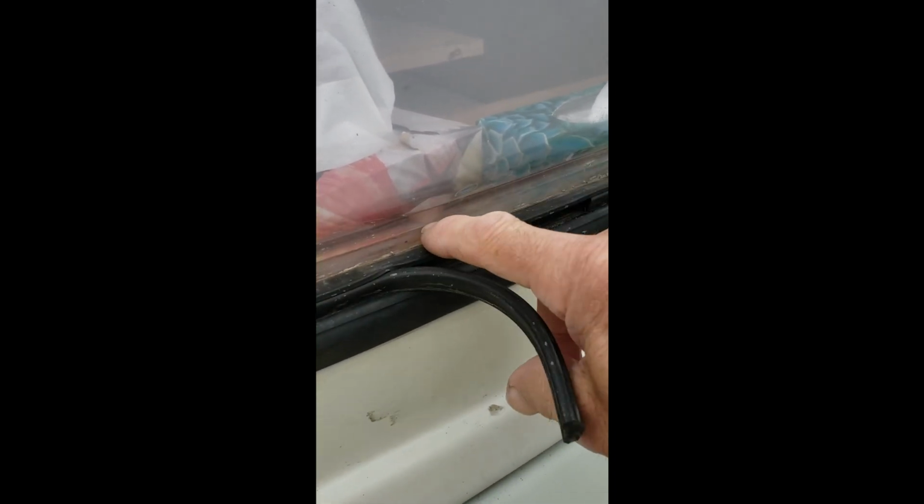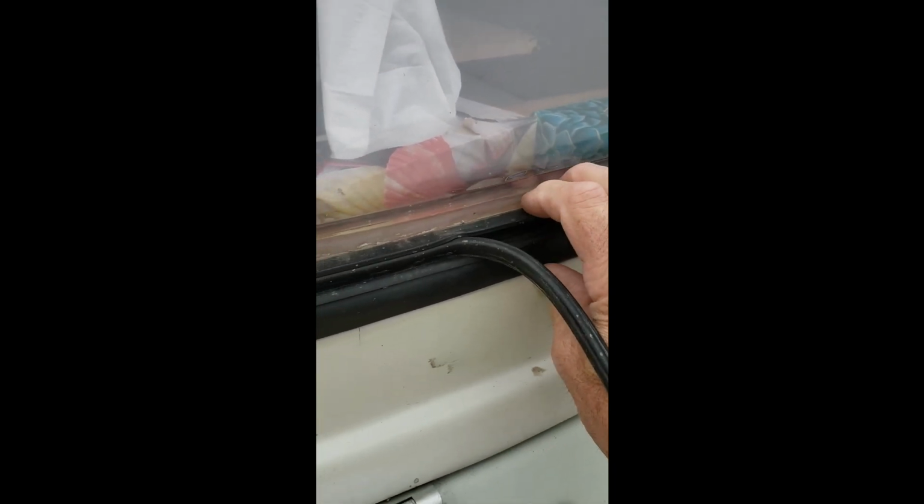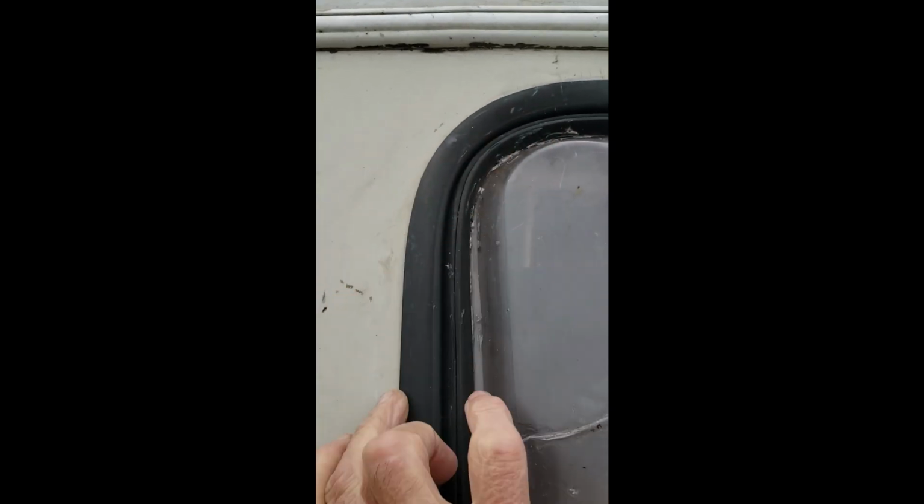So here goes. To try taking the glass out and putting the strip caulking in between the two pieces. So I'll take this out, I'll pull the glass out, plexiglass, and then afterwards with this out and the window back in, I will caulk around here, or maybe even before the window goes in, and take it all the way around to the top, each side.